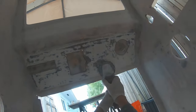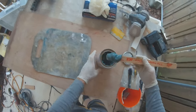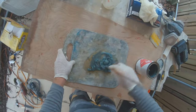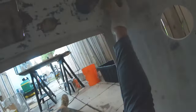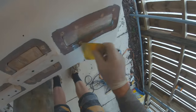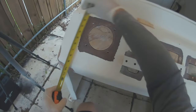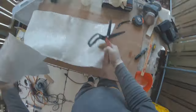This is a product I like to use a lot — it's from Fiberglass Florida and it's their radius putty. It's a polyester-based material, almost like a body filler, but it stays tacky for a very long time, which is good for polyester work because you really want to put polyester products on wet on wet — you don't want to put polyester over 100% cured polyester. I'm filling in the gaps on the back side of the filler so that the biaxial will lay flat, then filling some larger gaps on top, and then measuring and cutting all the pieces of glass I'm going to need.